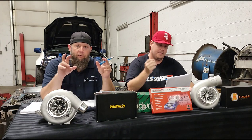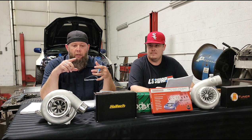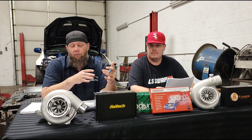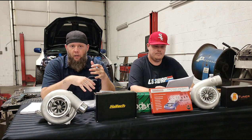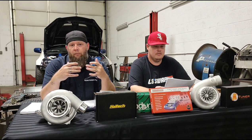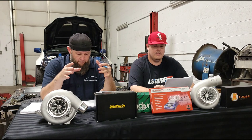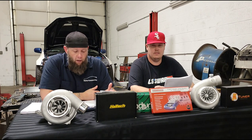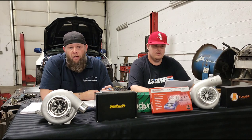If the car is leaking, I have to redirect my attention from tuning to making sure it has enough oil halfway through the session. That's the main focus of the checklist. We do a little inspection before it goes on the dyno, but there's some stuff we can't catch. The first section covers electrical issues — we don't want any exposed wires. A lot of this sounds like common sense, but we're looking for proper crimp or solder connections on all wiring.